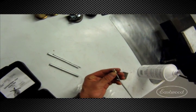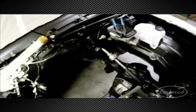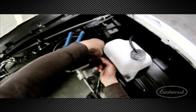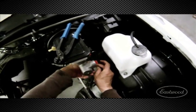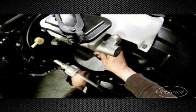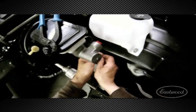What we're going to do is mock up the route of our brake line. I'm just going to use some safety wire here — you can use a coat hanger or some welding wire, TIG rod. We want to come off the rear port of the master cylinder straight down. Here's where we want to introduce our strain relief — I want to have a coil here. We don't want to just go straight down rigid to the frame, because anytime we have any movement it's going to start working that line and cold-work it right there, and you're going to have a fracture.